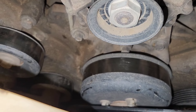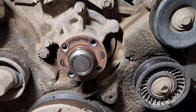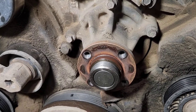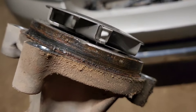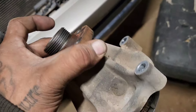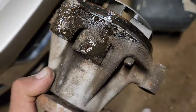I have to get the fan off because I have to get the pulley off. Bolts like this one here and this one here, I cannot get to unless I pull this pulley off. Now that we have the fan and the pulley off, we're going to get this water pump off — a few 10mm bolts, then we're going to clean the surface real quick and put the new water pump on. Everything is reversed. This was pretty hard to get separated, but it is out of there. I'm going to clean this surface and then put the new water pump in. When I pull this one out you can feel that the bearing is a little loose, and it's probably enough to make some noise. It wasn't enough to start causing really bad problems with the belt yet, but it was getting there.